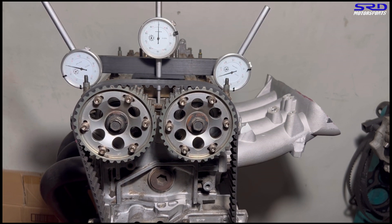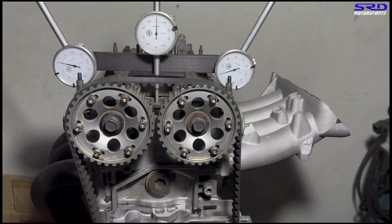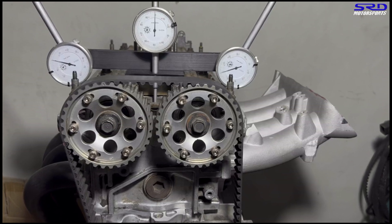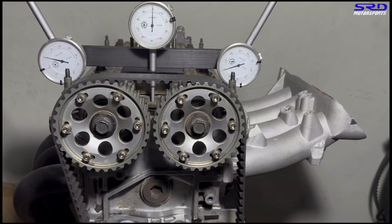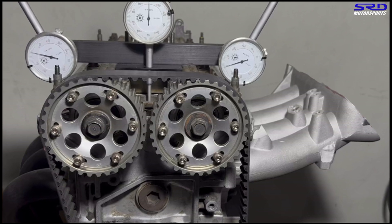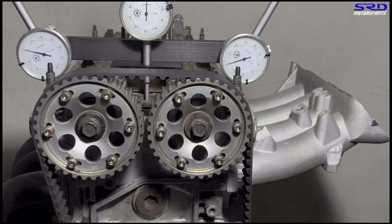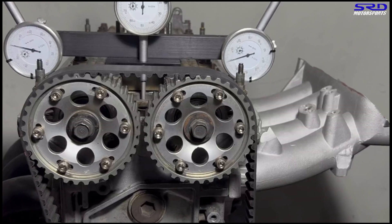Locally it's funny because people want a racing cam, but when you think about it, the system isn't even efficient. I call it the system because it all has to function together. If you put a racing cam and your induction is inadequate and your exhaust is no good, you're just giving more stress to the engine and not even making it run faster. And then you increase compression and start pinging. Isn't that a common local trend? And to improve the intake, remember this illustration I made.